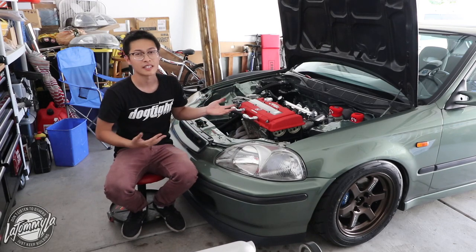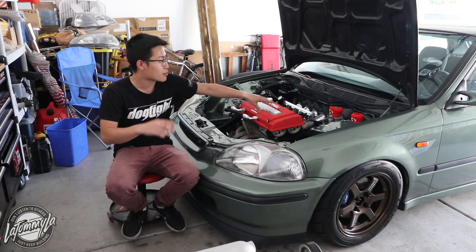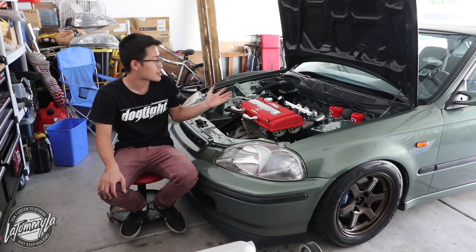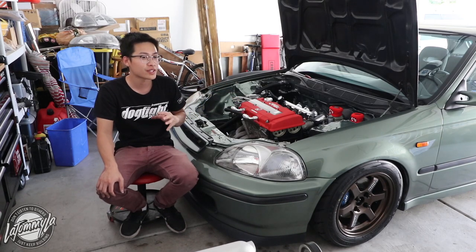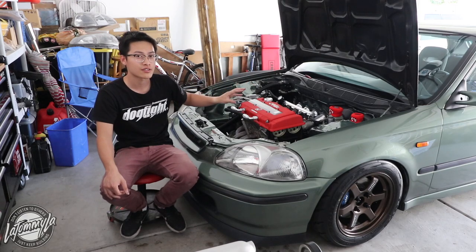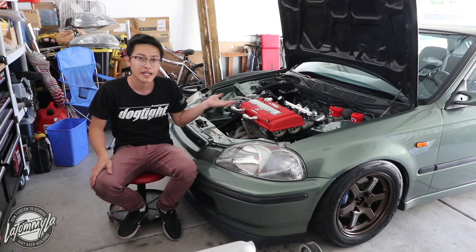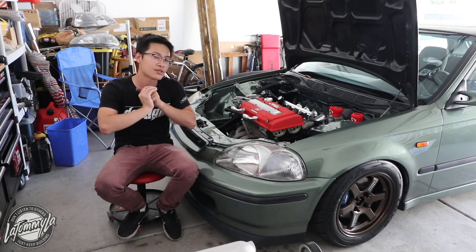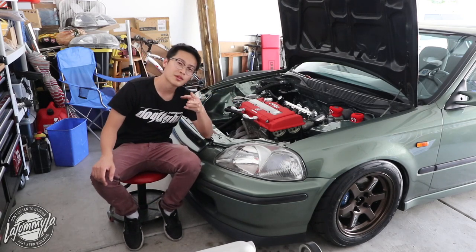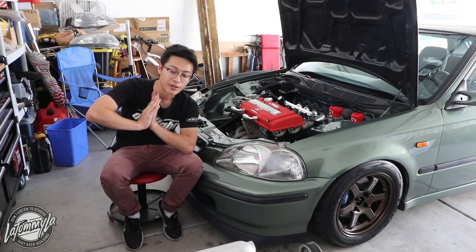I am running TWM, also known as Borla Induction now — TWM sold the company to Borla. I bought these used for $950 on eBay, already fully refurbished and resynced. They normally go for roughly two thousand dollars new. It comes with fuel rail and fuel pressure regulator but not injectors. The original stacks I changed to VW stacks — they're a lot taller. I still have to go back for a retune. When the car was retuned it was making 197 to the wheels, but the TPS wasn't reading right — the throttle cable wasn't pulling the butterflies open all the way, so it was tuned at 76% throttle. When I go back for a retune the car will definitely make more than 210. I also need to change my exhaust setup because it's bottlenecking at two and a quarter inches — I need a full two and a half. The throttle cable is already fixed and opens 100%. Anyway, ITBs are worth it if your motor is built — don't do it on a stock motor. Stay tuned, I think the next video you guys will be very excited about — we're actually gonna get started on the cage build.